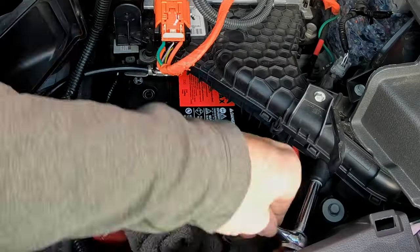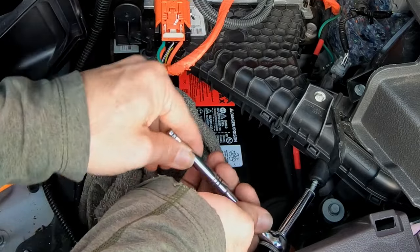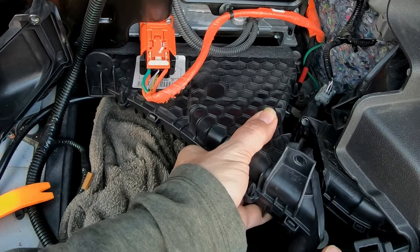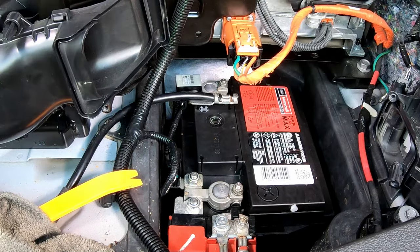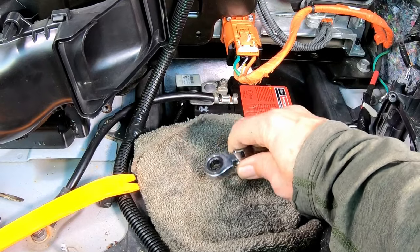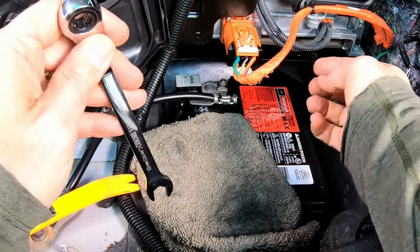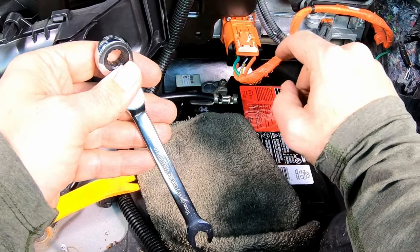Pry it out — that's the first piece of ventilation for the battery. With that out of the way, now we need to get this piece out too — another reason not to have the battery terminal exposed while I'm working with a tool very close to it. This piece comes right out just like so. Now we can see where the battery is in relation to everything. I'm going to cover this back up and remove the negative terminal first. If I remove the positive terminal first, in the process of using the tool I might short from positive to negative. If I remove just the negative and set it aside, I can touch negative to chassis negative and it doesn't hurt anything.